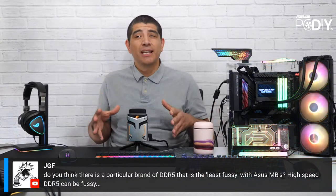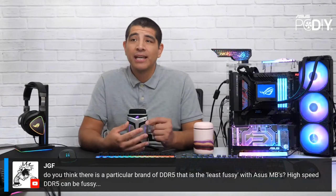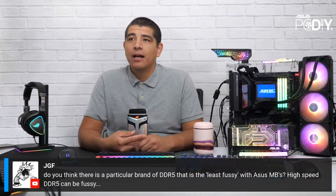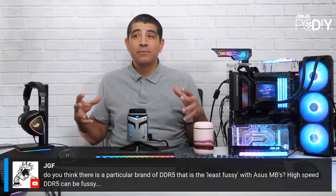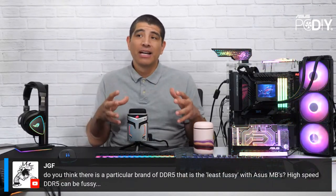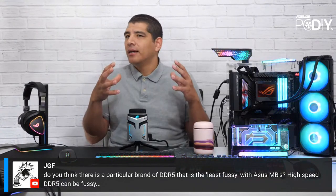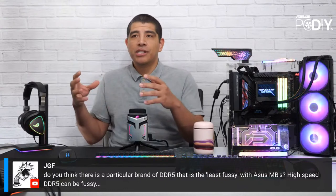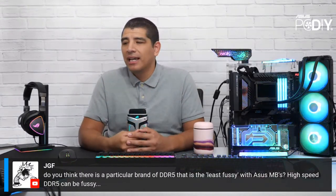I'm going to have a dedicated DDR5 overview video where I'll be talking about things like IMC quality, how that affects DDR5 scaling, how to account for variability in IMC quality if you buy a high-speed kit and your IMC can't support it, and how to drop dividers, how to account for things like DRAM density, population, and IC, and how that plays around with 2-DIMM to 4-DIMM configurations and different things along those lines.